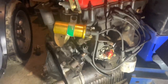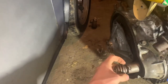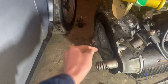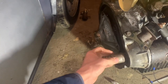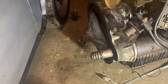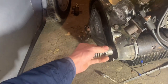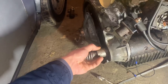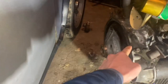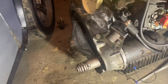In terms of what I've been doing, the starter motor did work - it's an inertia type - but it was getting a bit jammed up and wasn't engaging properly. Do not put any oil or lubricant on here because clutch dust will get onto it and cause it to stick. It's freed off anyway and it should engage. It might be that my battery was a little bit weak. You can manually put it in and it will stay there, then turn the engine over and it should force it back out. The ring gear doesn't look to be in bad order - that's a weak point on these with an inertia type, as the ring gear can get chewed up, but it looks okay.